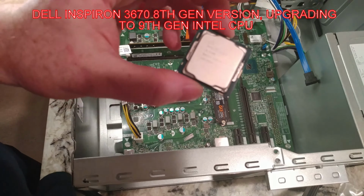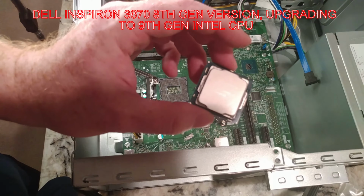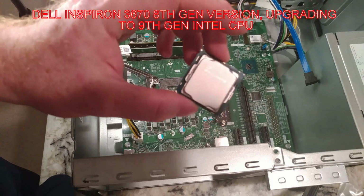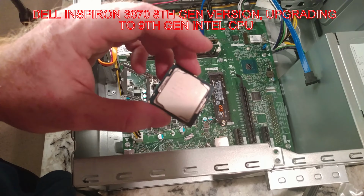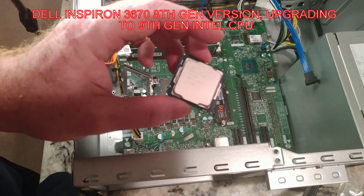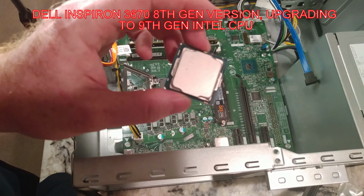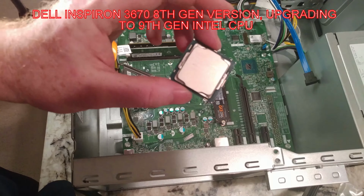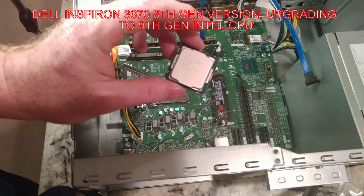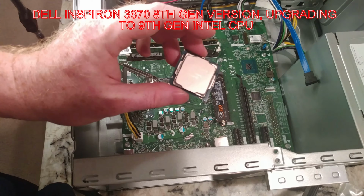Alright, so in some aspects this is actually a downgrade. The i3-9100 has a faster single core score, which in some games and some other things this actually could prove to be better than the i5-8400. But for your quad core and multi-core scores, those are lefts with the i3-9100. At least multi-core definitely is. I'm not so sure about the quad core one, but so that is not going to be as awesome for any workstation type taskers, such as CAD and doing animation, things like that.